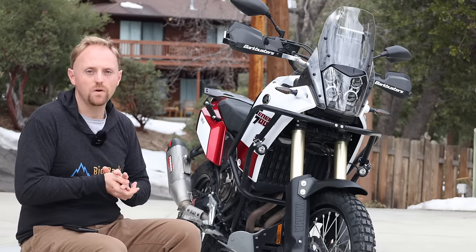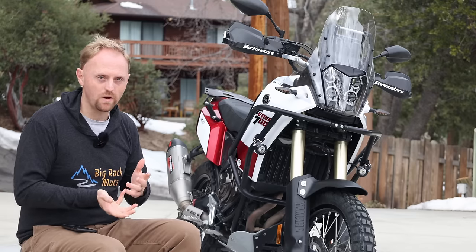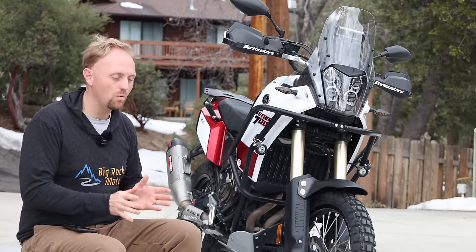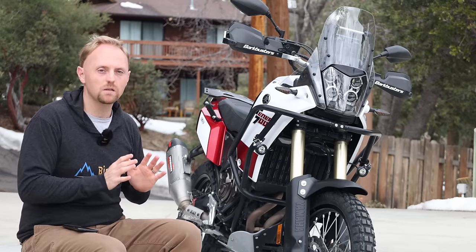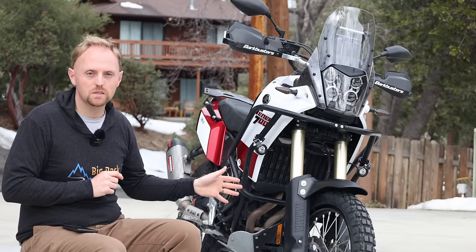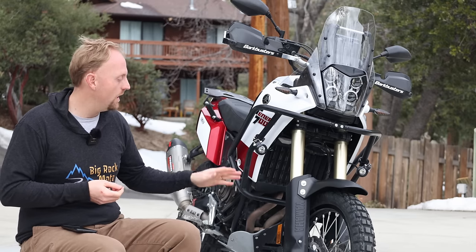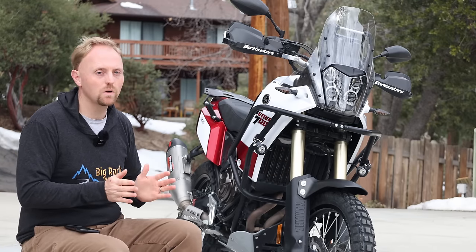So what's the solution to the spring rate? It's very critical that you understand you have to address the spring rate before you worry about any of the damping or changing out any other components. Always get the right springs first, especially if you're on a budget, because that's going to be the most important thing. It's pretty easy to change out the springs if you're mechanically inclined — I did it myself. You're going to need a spring compressor for the rear shock, which I'll link in the description. Changing out the front fork springs is pretty easy — I like to change the oil when I do it, take the forks off, dump the oil, flush it out, put in new oil and the springs.